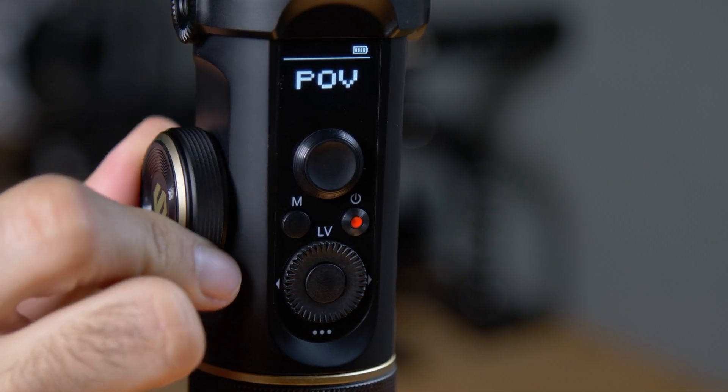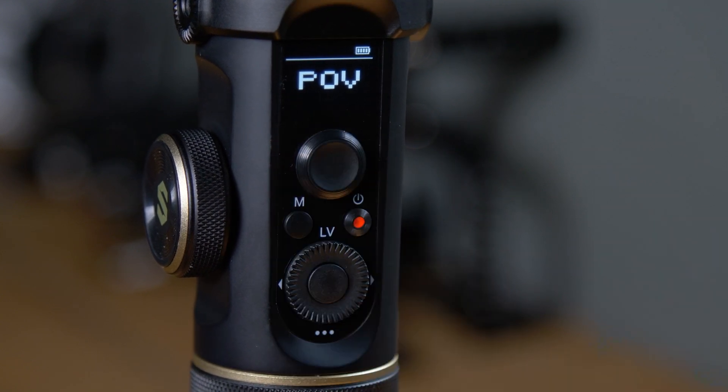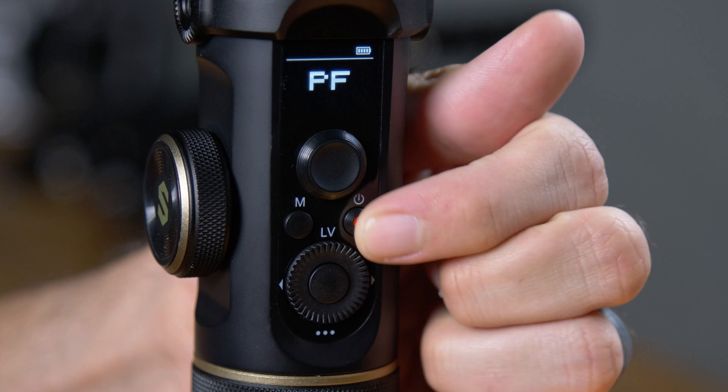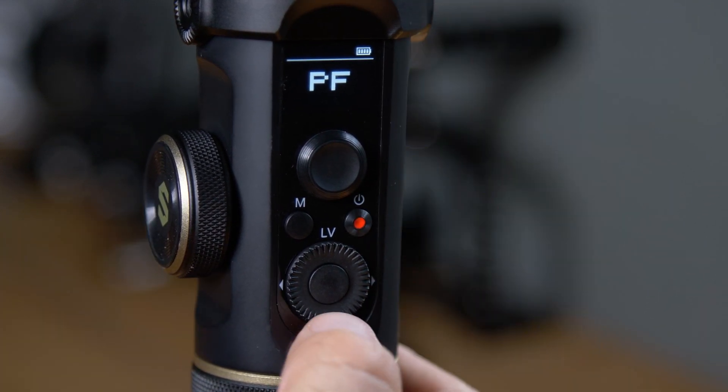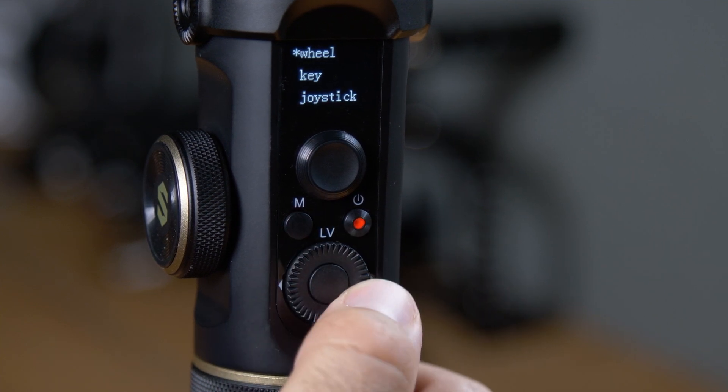You still have the focus wheel on the outside so that you can plug your camera into the gimbal and pull some focus that way. You have the joystick to control the gimbal, the mode button to cycle through your modes, an on/off button which is also your record button, and a dial which you can use to go into your menu and cycle through your settings. This still uses the 18650 batteries inside of the handle grip — you just unscrew it, and that reveals your batteries inside. You pop these out, throw them on a charger separately, and charge those. You get the charger included along with the three batteries, and these batteries give you about 12 hours of run time.